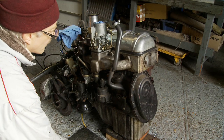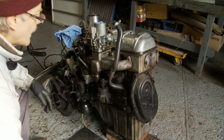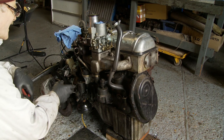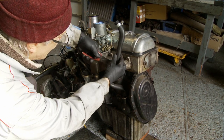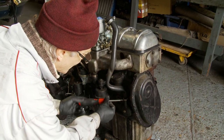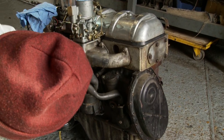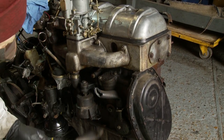I'm going to be taking off the inlet manifold complete with the carburettor and the CRC, because they're all fine. But in order to do that I just need to disconnect several things. First of all, we'll take off this breather pipe — it's a damaged breather pipe anyway, so we will definitely be replacing that because it's actually split. And that shows how old it is.